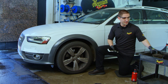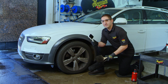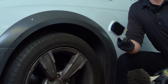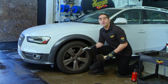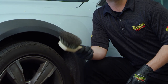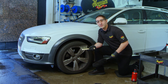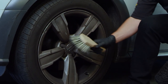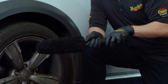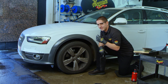You also want to think about what you're going to use to clean your wheel and tire mechanically along with that product. You have a stiff or medium bristle nylon brush — that's very effective for cleaning the tire but you don't want to use it on the wheel face as it can scratch. In addition, you have a softer wheel brush that won't scratch the wheel face, which you use to agitate and get into the nooks and crannies. Lastly, use a specialized brush intended to get behind the spokes so you can get the barrel of the wheel — that's a nice pro tip to really take your wheel cleaning to the next level.